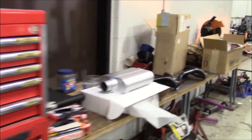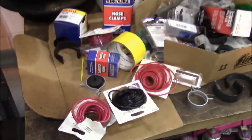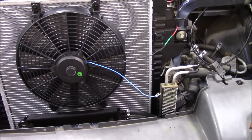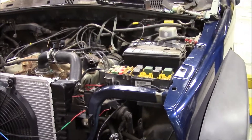Here's what we've been doing. We've got our mufflers here, we've got our headers — our little shorty headers we're putting on it. We got them painted up yesterday. We've been working on some wiring, as you can see, our little pile here. Radiator's in it, the cooling fan's in it. We've got the power wire run to the cooling fan — we just have to run our ground. We've got our voltage regulator and ignition box wired up. We've got our power steering, our belts are on it, and we're waiting to put the carburetor on it.